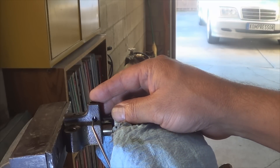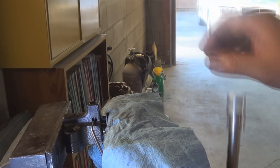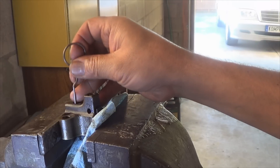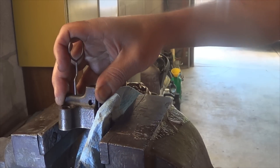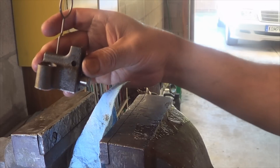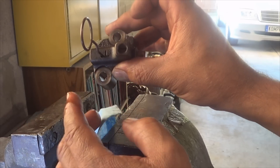When compressing your hydraulic tensioner, use a small clip to push the locking pin up. Then as you compress it, you will be able to drive it in without breaking it. Once it's compressed, insert a pin — it's going to keep this part from coming out and lock it in place. Put a little pressure as you release the vice. I put a shop towel where this part contacts the vice so it wouldn't get damaged. Now it's fully compressed and I can install it on the engine. Once it's installed and the bolts are tightened to the proper spec — which is 21 foot-pounds — release the pin and it will allow it to operate.